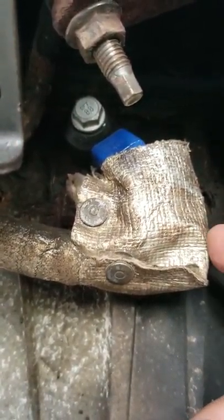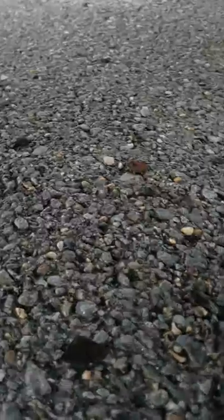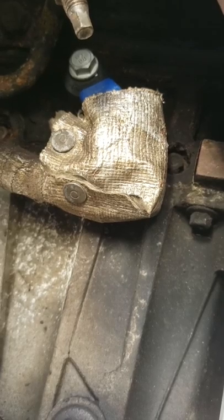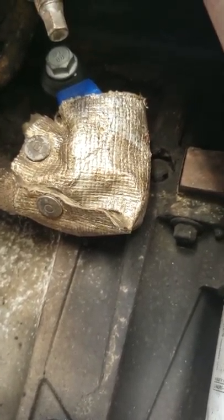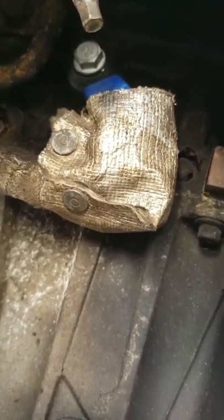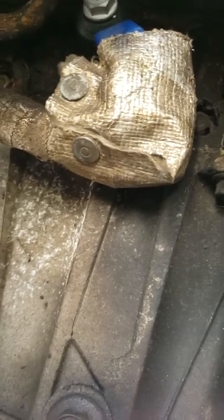The sensor was melted. The connector from the cable that runs into the computer was also melted, so they were fused together with the sensor — it was a hard time removing it. I had to break chunks of it off. The only thing is the connection — I was left with just the two little plugs to connect to the new sensor. I put tape on it and connected it like that, because apparently the dealership doesn't sell the replacement pigtail separately — it's already integrated into the engine wiring harness.